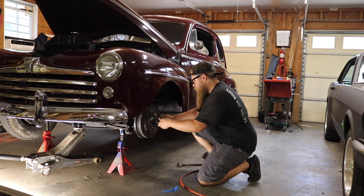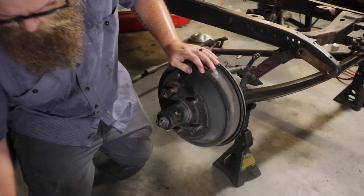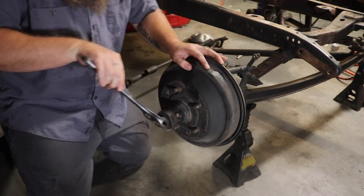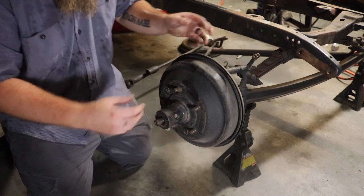The earlier hubs screw in and out, so get the dust cover off. On the inside you should have a castle nut with a cotter pin on it — sometimes I've seen bailing wire, that's what you used to do back in the old school days. Hopefully you have something holding that castle nut. Get that out of there and take the castle nut off. The only thing really holding the front hub on now is possibly rust against the brake pads onto the hub, or any little notches or grooves the wheel bearing has made over time on the spindle.